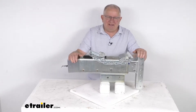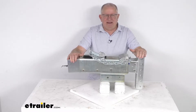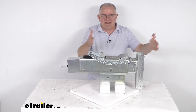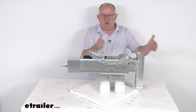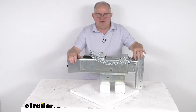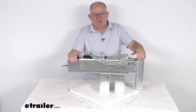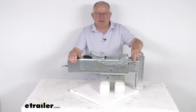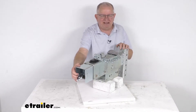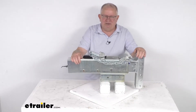This hydraulic actuator will activate your trailer's brakes when your tow vehicle slows or stops. When you apply the brakes, deceleration occurs and the momentum will push the trailer toward the rear of your vehicle. With the surge brake system, the actuator is triggered as your trailer moves forward once the tow vehicle starts to slow down. The inner slide portion of the actuator contracts and applies force to the master cylinder in the back, which supplies the necessary hydraulic pressure to engage your trailer's brakes.